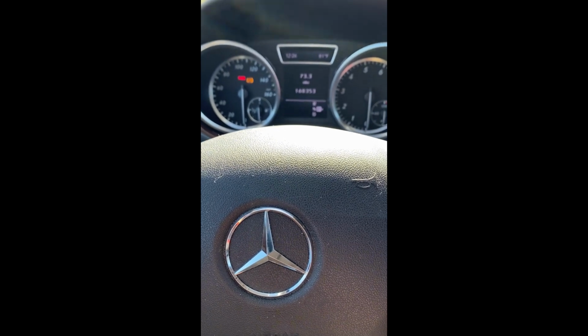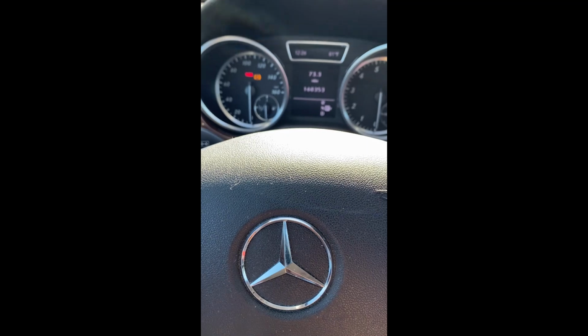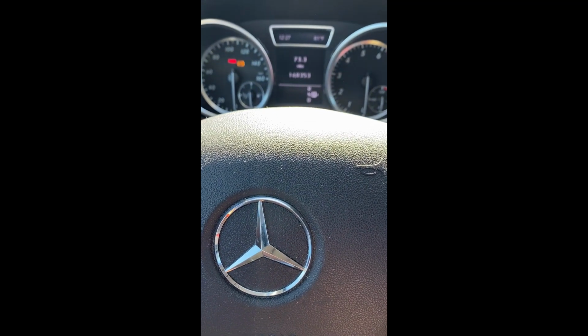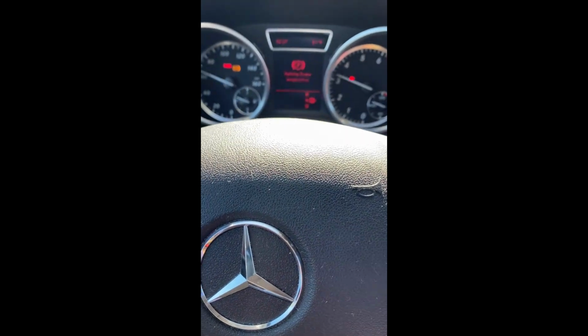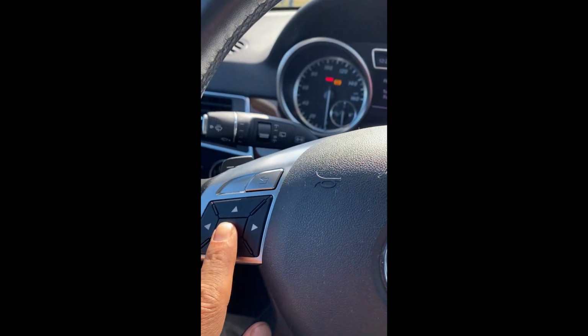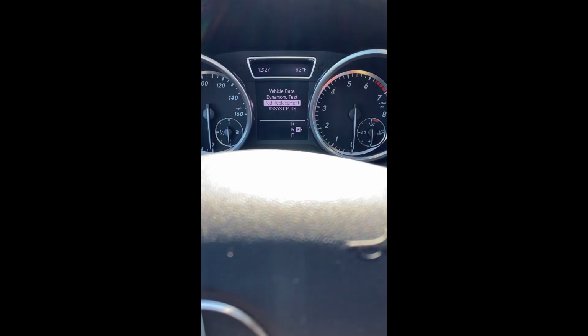Okay, I forgot to show you something, right? We deactivated the electric parking assistant. Now we have to activate it, right? So we push the ignition button once. To exit fitting position, click on OK. Caution. Fitting position, to confirm, click OK. Fitting position has been exited. To confirm, click OK. Okay.